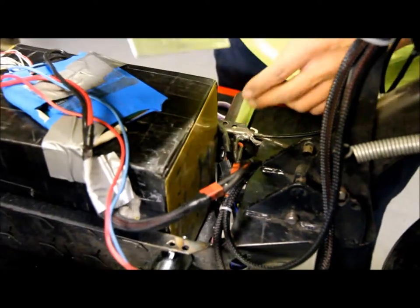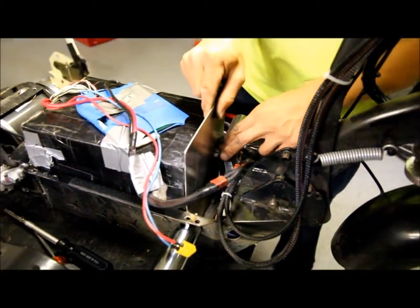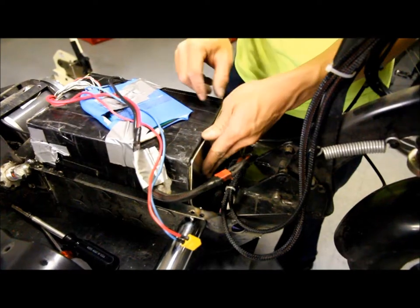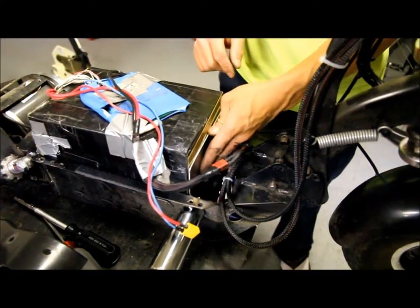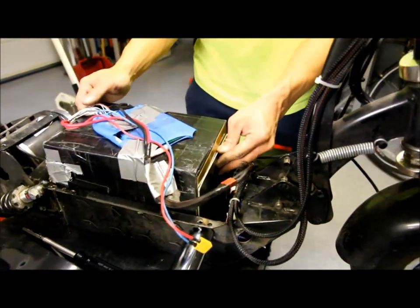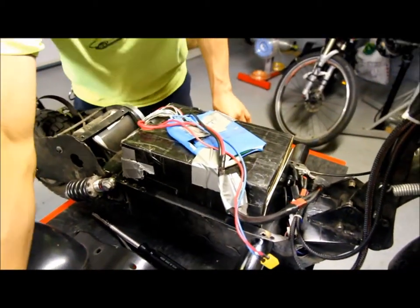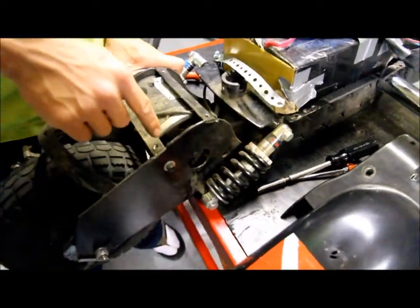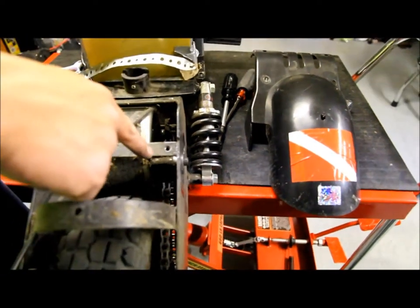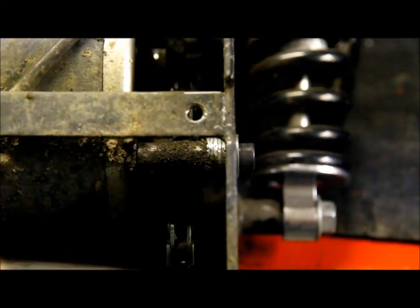This aluminum plate that I'm gonna slide in place, I had a custom cut so that this is gonna protect the battery from the hex nut. It's also gonna lock this battery into place so it doesn't shift around. I have spaced it about 5 washer spacers to the left so that it aligns with the pinion gear, aligns with the rear sprocket. So as you can see down here, I have 5 washer spacers.